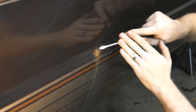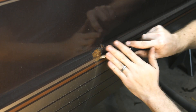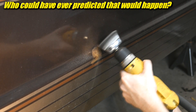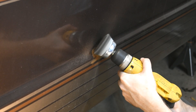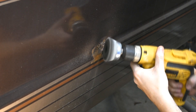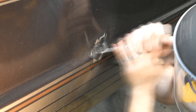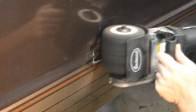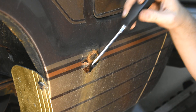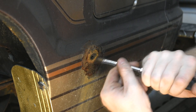Here I'm kind of removing more rust. There's little patches of rust here and there. I think this particular one was a paint chip that I just kind of left, and then 15 years later, lo and behold, it rusted out. I was still being way careful — if I would see this now, I would just say break out the power tools and needle scale it off. The all-important screwdriver test: will the screwdriver punch through the rust? No, it did not. This didn't look so bad, but I think I'm still going to need to patch something there. A much worse looking hole at the back — this one chipped off much quicker. It also failed the screwdriver test, so that was fun.